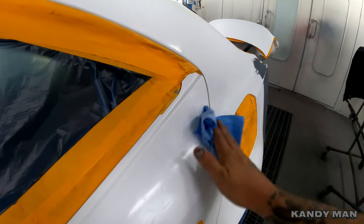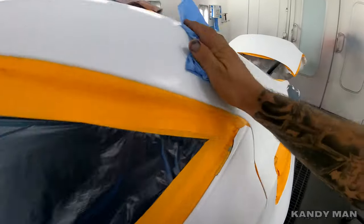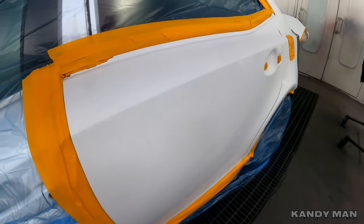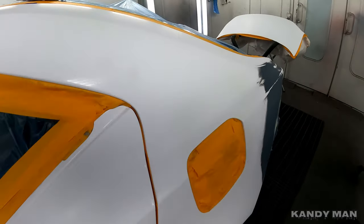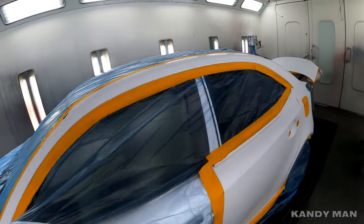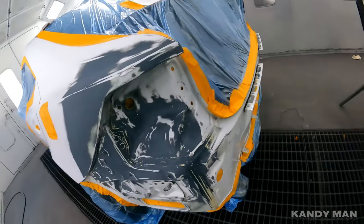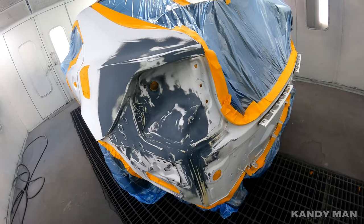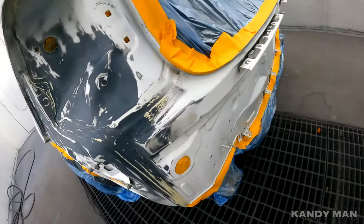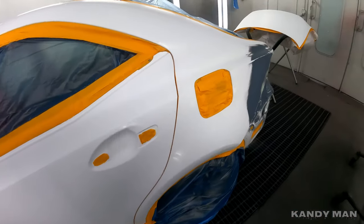You've got to sand it out of the actual scratches to get it to come out. I've been using these super flex Nortons and they definitely had a couple bite me in years past, and I'm sure any of you in the business have too. Definitely want to check over your pearls, and in this weather with all the sweating going on there's more chance of that. We're going to shoot this '83 pearl job — we've got a new bumper blend, the trunk, and a repair around the taillight pocket. I ended up using a dark primer, but we're going to seal the whole rear body, not stop and do a blend — we do the whole thing.